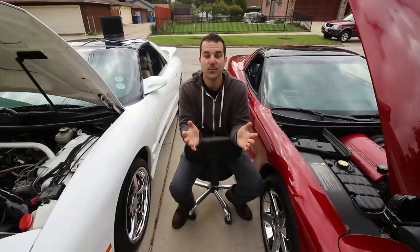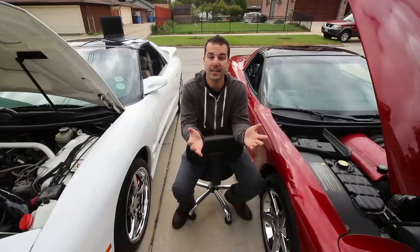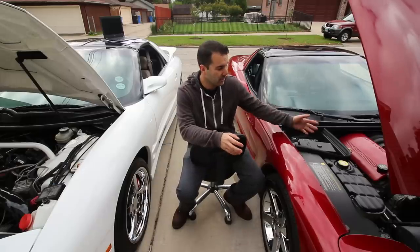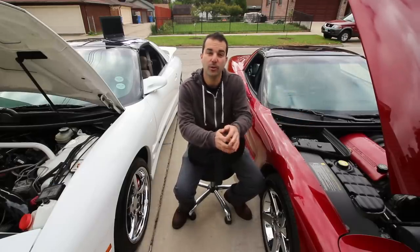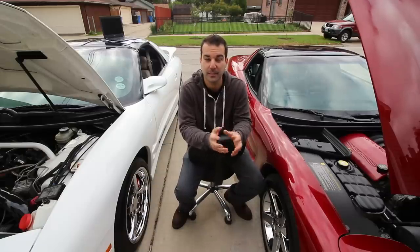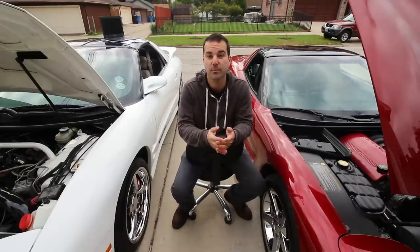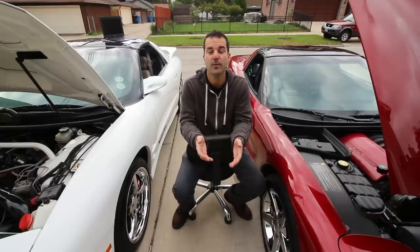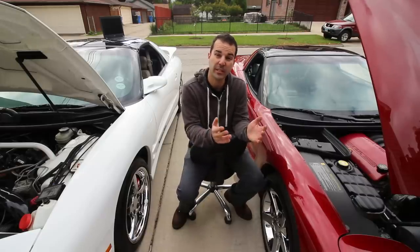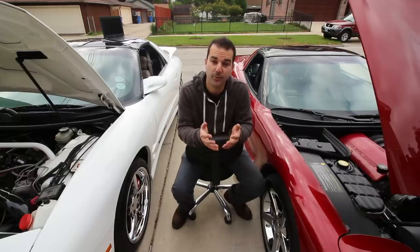And that leaves us with lean burn mode, or activating lean burn, however you want to say it. I think this is going to be the biggest modification that we're going to make to this car in order to reach our goal of 40 mpg highway. So what is lean burn? It's exactly what you guys are probably thinking. It's running the engine leaner, so leaner than 14.7 to 1. So the higher up you go numerically, so 16 or 17 to 1 air fuel, means you're running leaner. If you're running leaner, you're using less fuel and you're getting better fuel economy.